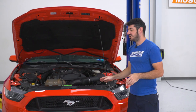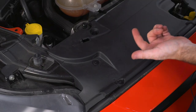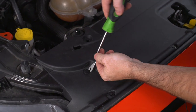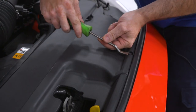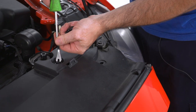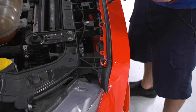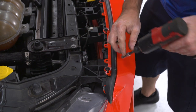For this install, we're going to have to get the car up in the air a little bit and remove the front bumper — it's a pretty simple process. Starting by using the clip tool to remove the clips that hold the upper rad cover on, then pull the rad cover off. With the rad cover out of the way, take the 8-millimeter socket and remove the six 8-millimeter screws along the top of the bumper. Don't forget the 7-millimeter screws hiding underneath the weatherstrip — just use a 7-millimeter socket to get those out.